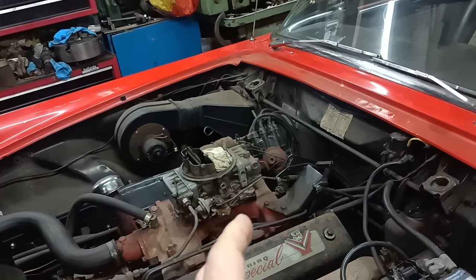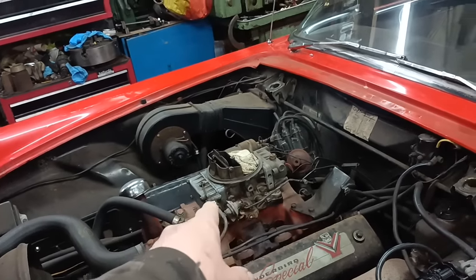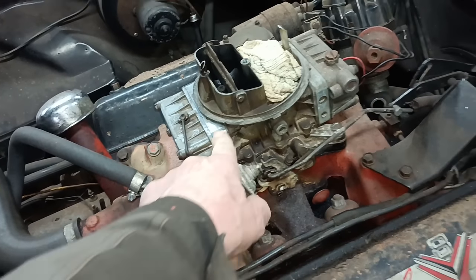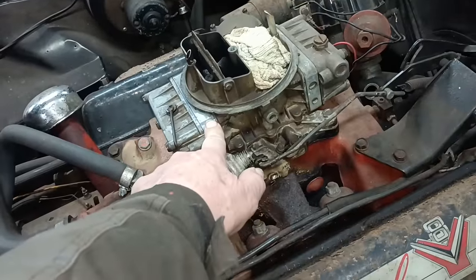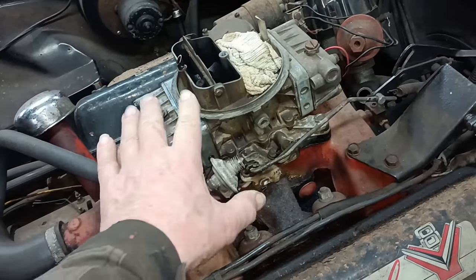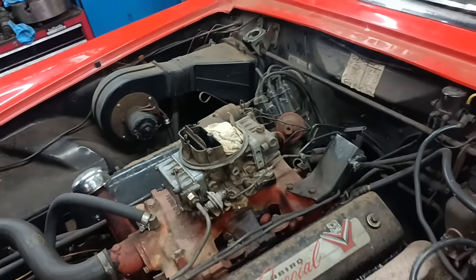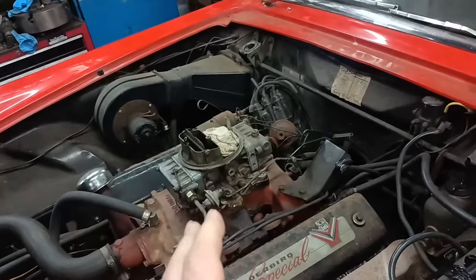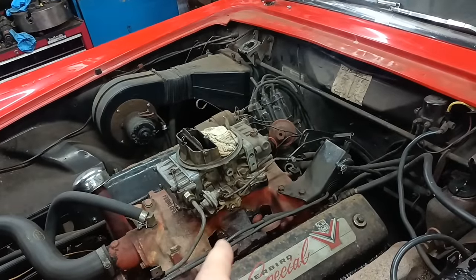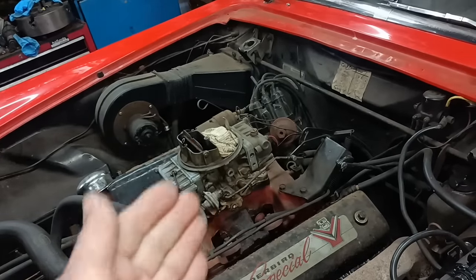What I think I might do, as soon as I've got plenty of gaskets, is take this off, put the power valve and the jets into the other metering block and put it all back together as it was when I last ran it, and when I did that start up from it sitting for a long time. I'll put all those back together and get it started, take it for a run, and see if I can go and get some fresh fuel in it. If that makes a difference,